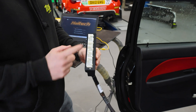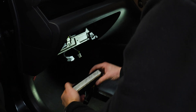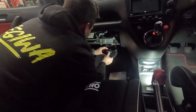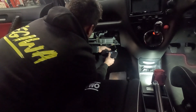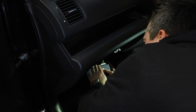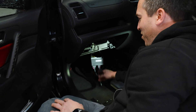We'll plug the standard Honda ECU plugs into this. Again you can't get it wrong — they only go one way round. Push them so they click. So that's those installed and then you can see the tail here ready for the Elite.